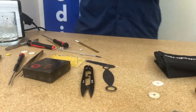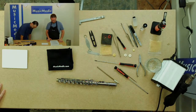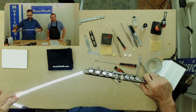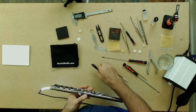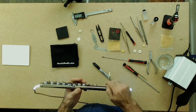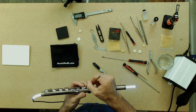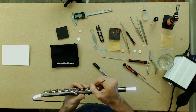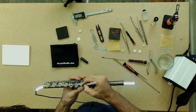Many of you are probably wondering how we get that out of there, especially if there's no glue. This is where the partial shim stuff is very, very cool. What I like to do is keep the leak light in there, grab a Sharpie and my feeler gauge, then push the pad down until I can feel it start to not grab. Right around between 5 and 6 o'clock, I will take the Sharpie and mark the key itself.